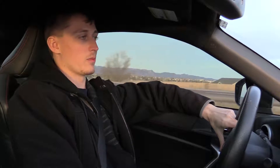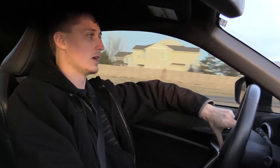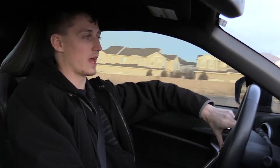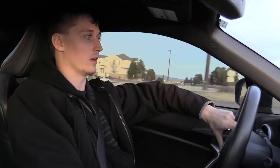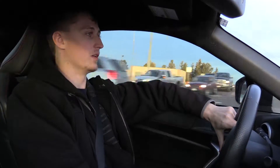The engine issue I'm trying to avoid is that really rough dead spot. Changing out the ECU to a Stage 1 — since I have no change in headers — is supposed to help with that. It's also supposed to increase gas mileage in the city, but I don't really live in the city, so I probably won't see much of a performance gain there. But at low revs, going from light to light, everything will be more consistent with gas mileage. So again, above the dead spot.